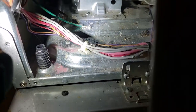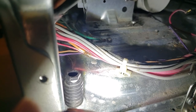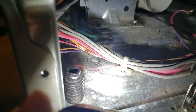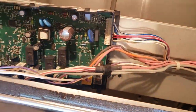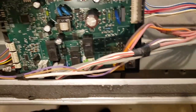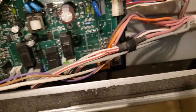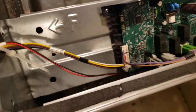Right in here, I took this electrical tape apart and you can see a connector. There are actually three wires spliced together there, and then it's a pink and white wire — like this one. If you can follow that and the brown wire up to here, you can actually test this brown wire and the pink and white to make sure the wires and everything are going all the way through, as long as you've got the door closed or hold it with your hand.